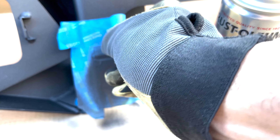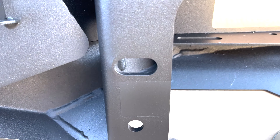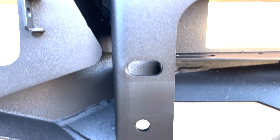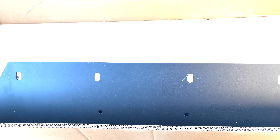I'm going back to see how this dried and see how the flat black Rust-Oleum high-performance paint matches with the original coat. It's actually not that bad. Just got to throw a very light sand on there to get the edges where the tape was, but it's a pretty good match for the most part. When the bumper arrived there was a big gouge in the box and I knew there'd be some minor damage, but this tiny little scratch is not a big deal. I'm going to lay tape from edge to edge and paint this whole back section so it looks like an intentional design — because even though the swatch matches in texture and reflectiveness, it doesn't match perfectly since it's powder coat versus paint.